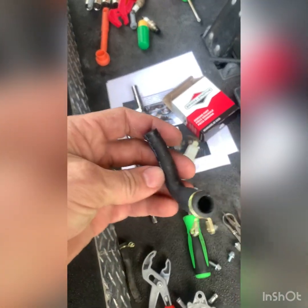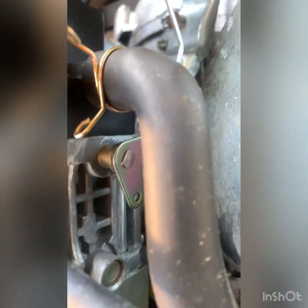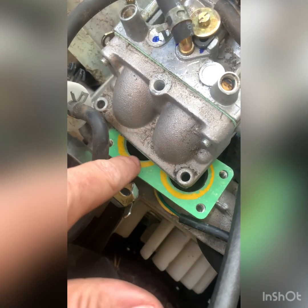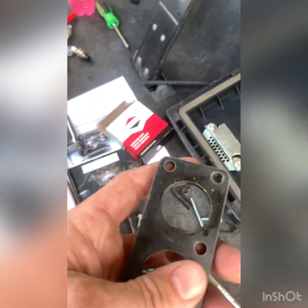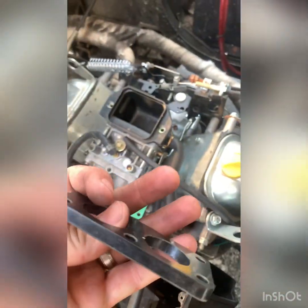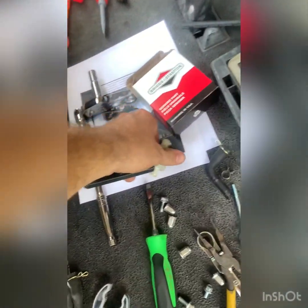With the elbow, we took a piece of quarter-inch fuel hose, ran it down up underneath the carburetor, and put the factory hose clamp back on. I also noticed this crappy-looking yellow stuff on the gasket — it's not flaking off and it's not going down into the intake. So all we've got to do is get a few pieces off of the fuel spacer adapter and we'll get this put back on and hopefully get this thing fired up.